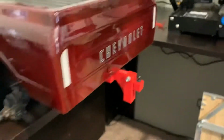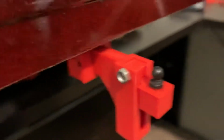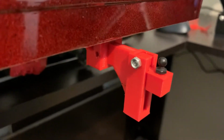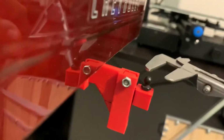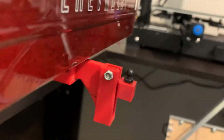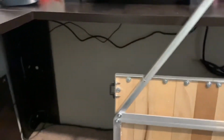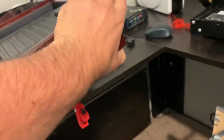We're going to be hooking all this up, putting this new ball on here. Okay, that's a little four. Actually, hold on, let's measure this real quick. This might be a 5, it's just not a 5.5. And if it is a 5.5, I don't know why it never worked. Let's see if I can do this. Nope, it is a 4.5 ball. That's what I figured. I thought it was 4.8, but it's a 4.5. Not gonna work. So let's take this all back off.